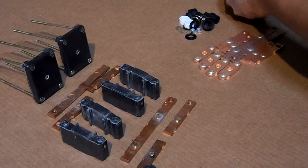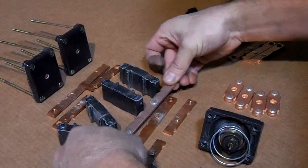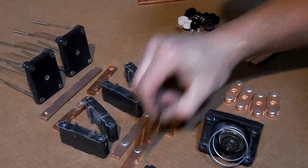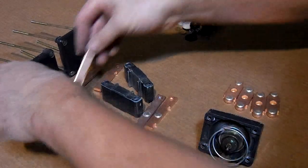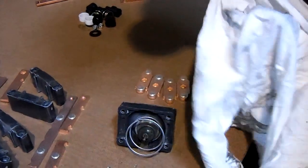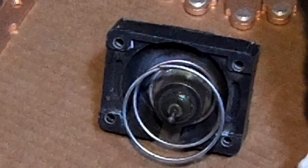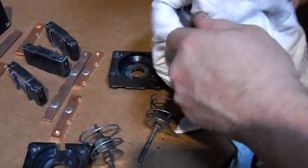We've got our new tip kit out here already. I'm just going to replace every piece that I take out. Watch the pieces that are threaded. Wipe down all your contaminants. Inspect your plunger pin — if this pin breaks, you're going to need to replace the whole assembly, or just the plunger if you have it. Check your isolators — they may be burned here real bad. All these signs indicate an entire contactor replacement, but these seem to be fine, so we're just going to replace the tips.